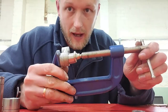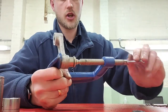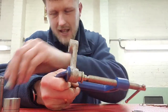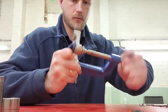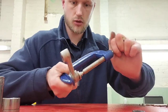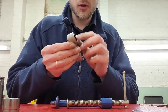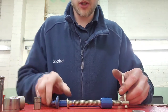Right, I've now finally got that in there straight. Once it's in and it starts going, it'll just go all the way home. Because it'll stop at the very end, you'll need to use the smaller socket just to push it in that little bit further and make sure it's flush with both edges of the dog bone. It's going in nicely now. Not using too much force at all, so it's not going to damage the bearing. Once there's a bit of pressure, just back off and check it. It's still sticking out a little bit, so use the smaller socket to give it just a touch more.